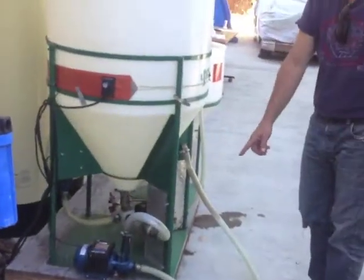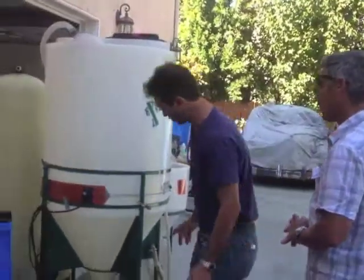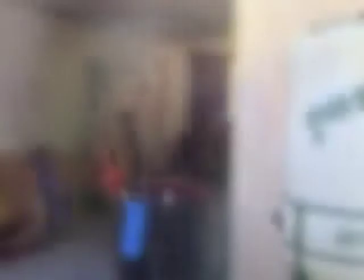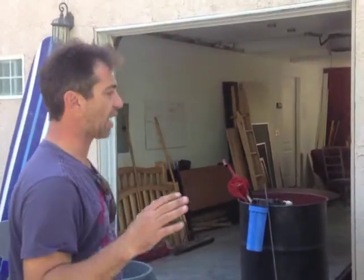This is your pump. Originally it didn't have a real pump — it just went in. If you're running in colder temperatures you have more problems with that. If you go to Walmart, they sell additives for biodiesel. I would buy them — they're really cheap, like 20 bucks. You can get one for winter which is an antifreeze for biodiesel, and one which is an injector cleaner for biodiesel for regular use.